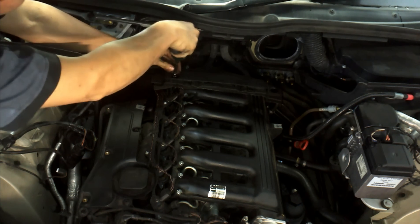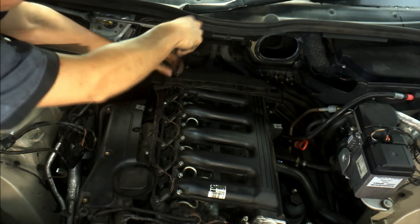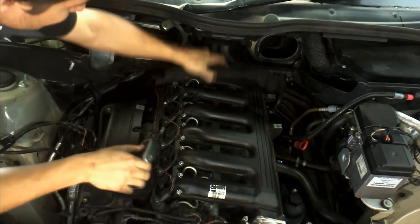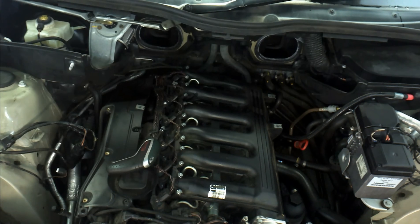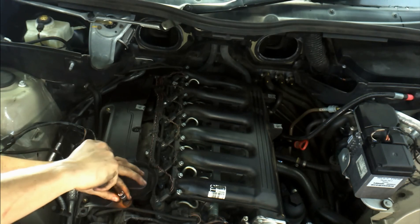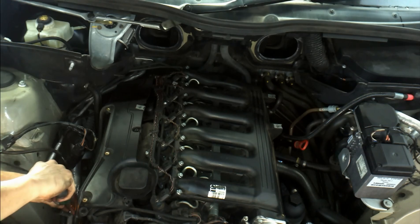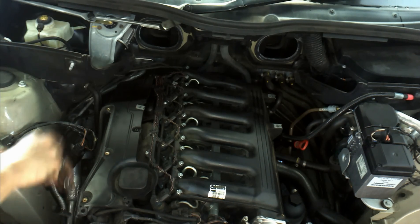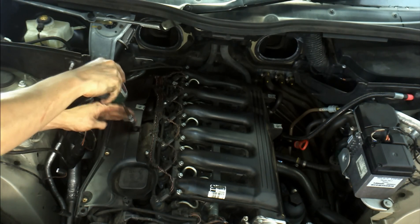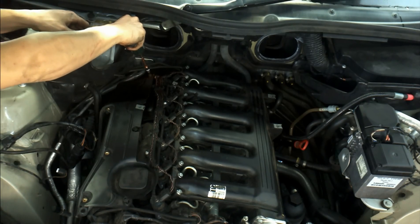We can get the rest of the screws out. There's another two screws for the engine cover — another two Allen keys. There's a little tiny bit of a cover there; it's really quite useless but you've got to take it off anyway. Once you've got that off, we'll start taking out the Allen keys for the main air filter. You've got another five Allen keys here and these don't actually come out — they stay in, which is kind of good if you're prone to accidentally dropping things in your oil filler cap.